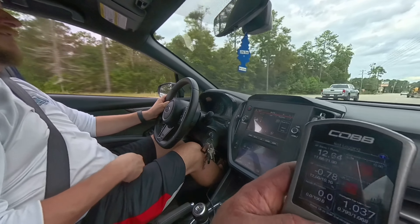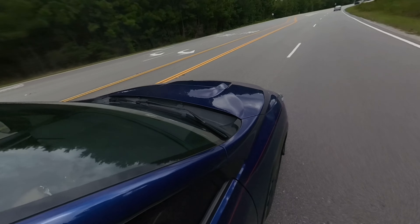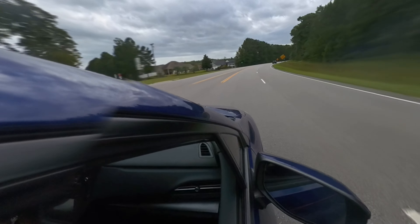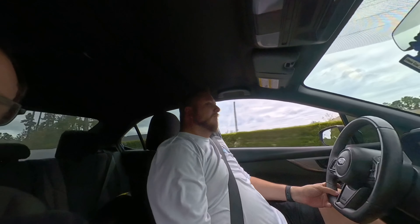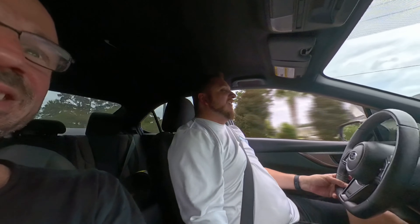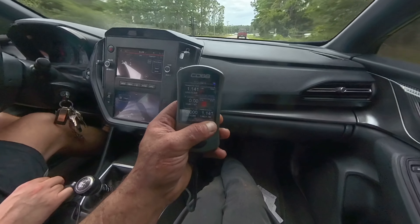The thing is we need to check if wastegate commanded boost has changed — it was commanding 23 pounds and hit 23, whereas before you were hitting 21, so you picked up two pounds. The squeaking sound is just because it doesn't have an anti-surge. The wastegate is actually opening now at 3 millimeters. Before, it was at full wastegate shot at the same boost pressure, so we are now hitting target.